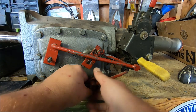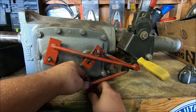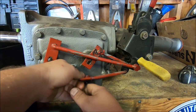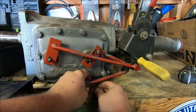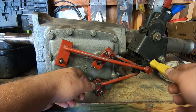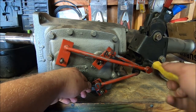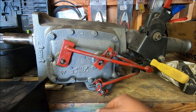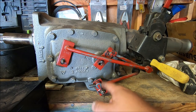It is in fact a little bit too long, so we're going to screw it in a little bit. Maybe it was a little bit too short - hang on, gotta pull it back off. Yeah, we'll unscrew it one turn. Alright, I got this one fitting. That reverse rod - this is still fitting a little bit tight. I'm going to have to add a couple more threads to this reverse rod, which is easy - you just take your tap and die set and thread this rod a little bit more.